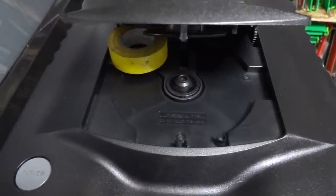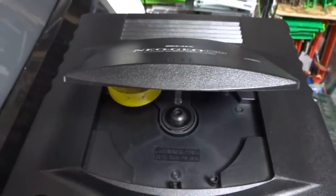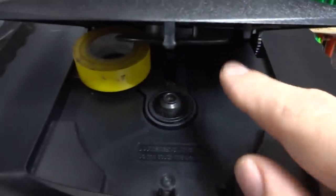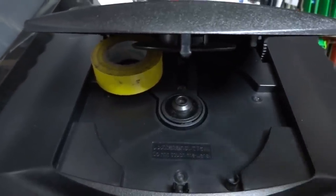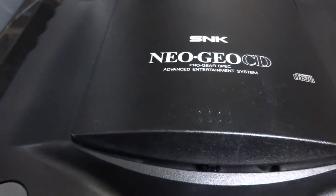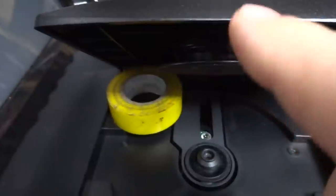The first thing we're going to look at is the front part and especially the door. On these top-loading models there's a latch at the bottom and a pin up front that keeps the door securely closed. There are also a couple of springs in the back of the door that keep the lid compressed. From time to time these springs fall out or go missing, and as you can see mine are gone, so the door may look closed but isn't necessarily closed.